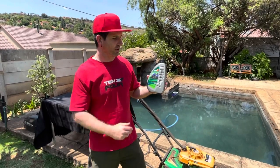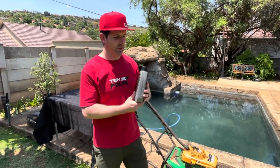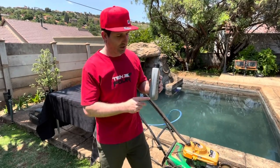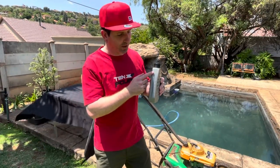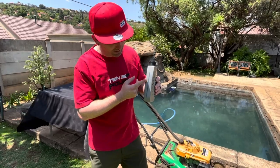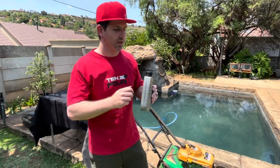So we're going to be using the Q8 gardening high-performance mineral oil. It's an SAE 30. This is a litre bottle and we've got the markings on the side. To fill this high-performance machine we need 600 millilitres of oil. So we're going to work it backwards from a litre — take it down to 400 and then check it with a dipstick and take it from there.